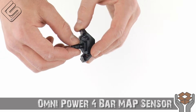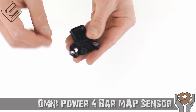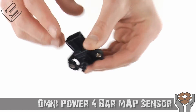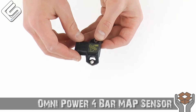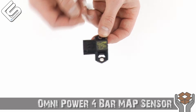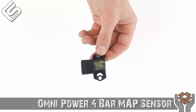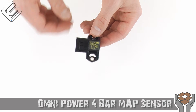And then it's plug and play. You simply unbolt your stock one, unplug it, plug this one back in — it actually comes with a new o-ring right there — and then it plugs back into your factory harness. However, this will require a tune 100%. You have to get a tune with this just because the voltage is going to be different going back to the ECU, and you need to tell the ECU exactly what to expect with this new MAP sensor.